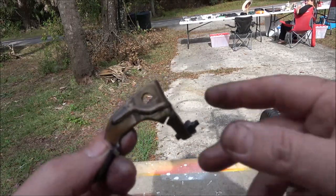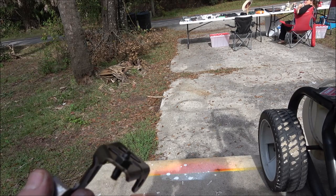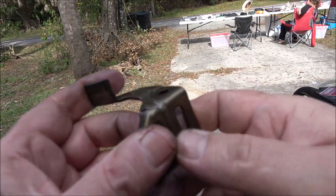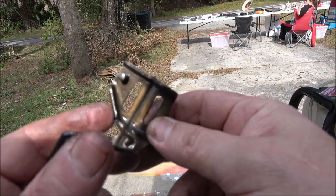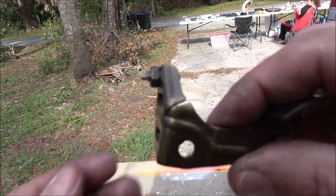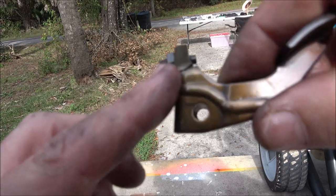He's got a good carburetor, good coil, stuff like that — and the pump — that he could use for parts for his other one, because they're the same engine. But that is the problem right there. He asked if I could weld it enough to confirm that was it. When you see that, that is it. But I don't want to take a chance of it breaking more and causing more damage. See how it's bent? That means that valve is not going to open when it's supposed to. Right there — that's the issue.